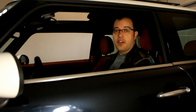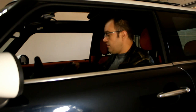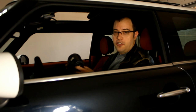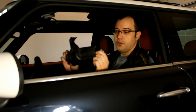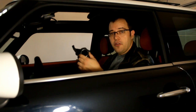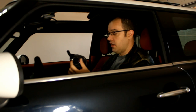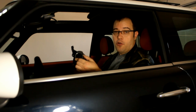That cold air hits the top of your air filter if you have swapped to an open-air cloth air filter. The next upgrade I would do is also a deletion. I've done a video on how to delete the muffler resonator for the hot side of the turbo. I used a $129 part from Alta, but this is just a tube. All you really need is a metal tube or even a silicone tube that is the same diameter on both ends as the delete pipe. You can easily go to Amazon and pick up silicone and clamp it on there, or find aluminum pipe of the same size. You have no delete pipe, and that's a pretty easy upgrade — won't cost you but 10 bucks.